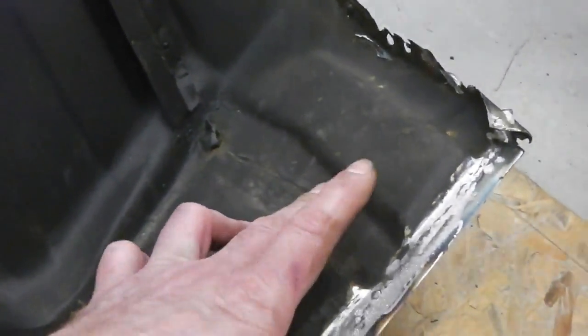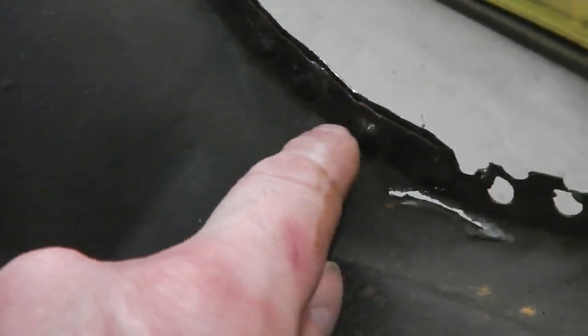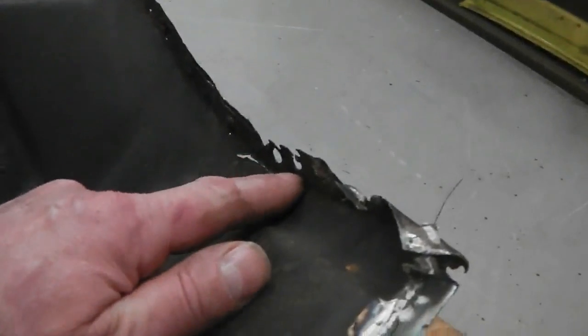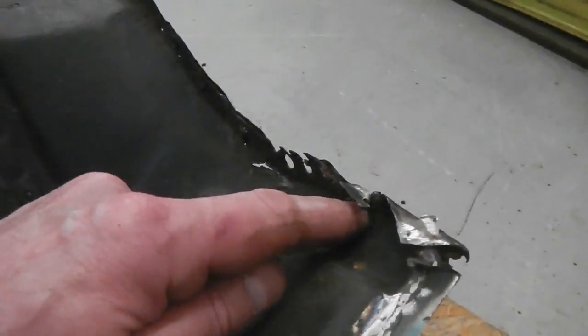A little bit to clean up here. Then these edges need repairing. Look how they're all right, but they're not mint edges. It's where I've managed to recover them, but it's enough to give me a nice template. So we'll get a cardboard template made. For this, what I'll do, again, I'll cut it halfway, so that we don't lose the fold and we get a nice edge. If you lose that corner, you can get water, and if I put another piece underneath, you'd get water getting trapped. You want to really keep that.